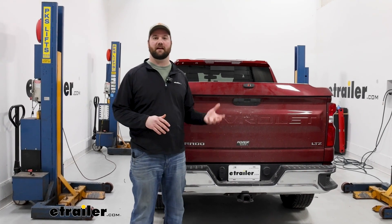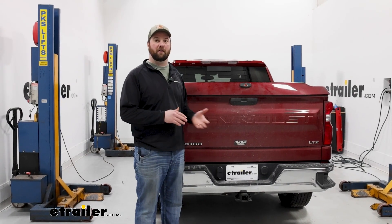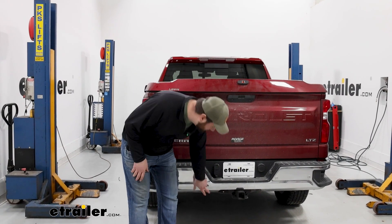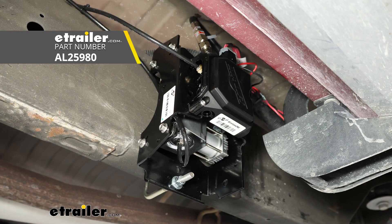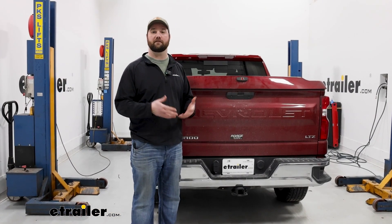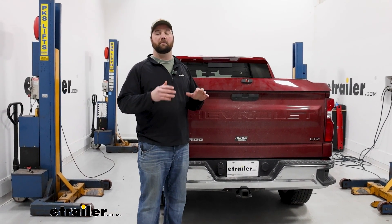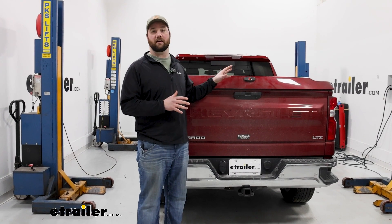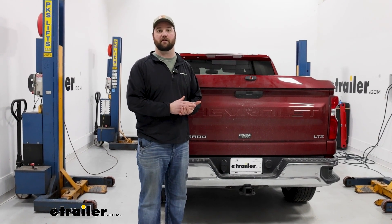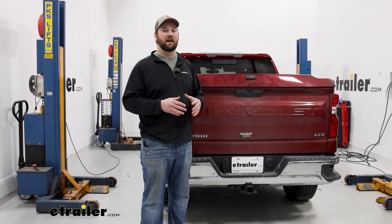The way you adjust the PSI in your bags is through the manual inflation valves. The kit comes with two manual inflation valves — we only have one down here because we've paired these airbags with an onboard air compressor. That adjustability from 5 to 100 PSI is only as useful as you have air to add or subtract. A lot of people swear they don't need an onboard compressor because they're always hauling the same trailer, and that works out great for them.